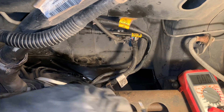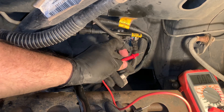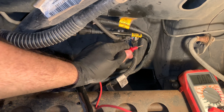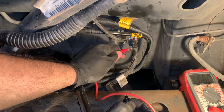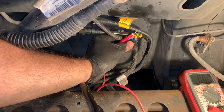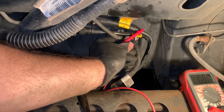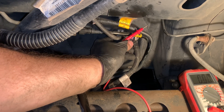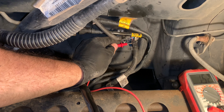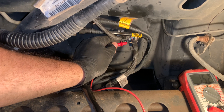Through the modern miracle of television, we are back. Our scan tool is hooked up, our car is on, it has auto-ID'd the car, and we are in enhanced powertrain looking at a fuel tank pressure signal of 1.5 volts. Got my multimeter here set to DC volts — get that signal return, find a good ground, and make sure we're actually hitting the pin. These weather packs, I always have trouble feeling in the weather packs — but I guess that's kind of the point. Can you guys see that? 1.52 volts. So our actual sensor and the PCM agree.